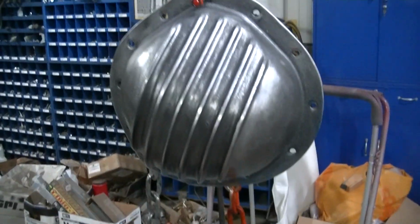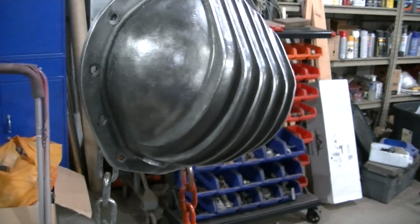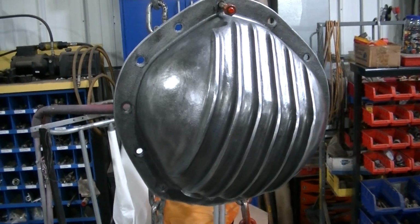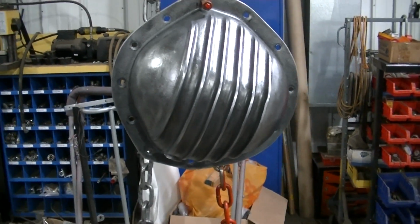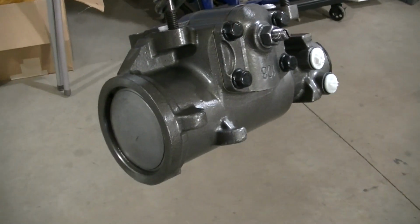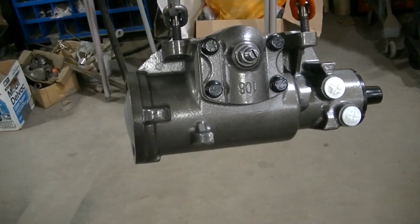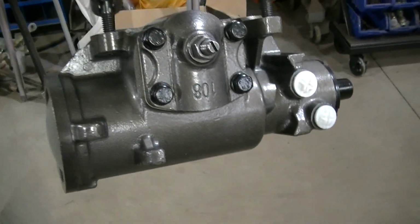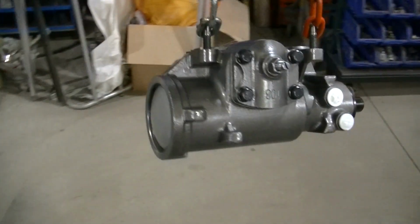Alrighty guys, so it's been, I don't know, 4 or 5 hours now, and you can see that the shininess has gone away. It's kind of a matte finish. It's still really soft, not dry by any means, but it's flashed, so it's not shiny. You can see it's a pretty flat finish, but it'll protect all this metal. This thing will not rust now, and it's got a really neat cast look to it. So real happy with that steering box. The steering box is going to look awesome on that frame.